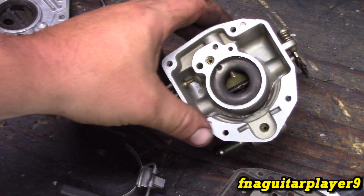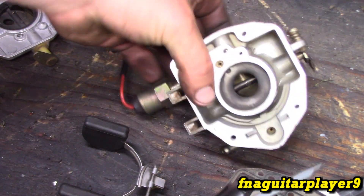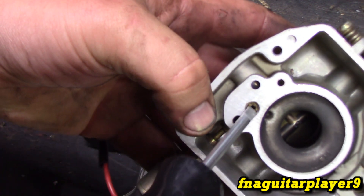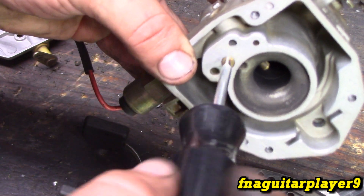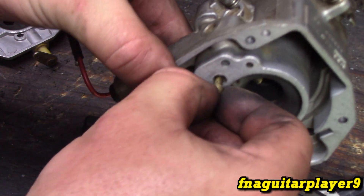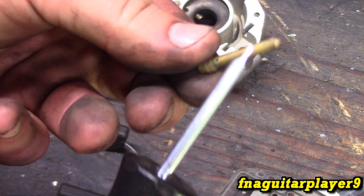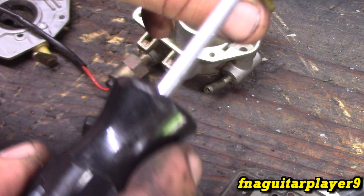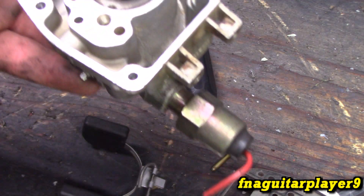Use compressed air to blow out the bowl - make sure you have safety glasses on when you're messing with carburetor cleaner because it's nothing to play around with. I highly recommend picking up a set of jet tools; it makes things a lot easier. If you look down this hole here you'll see the small jet - it's actually more like a nozzle. You've got a couple holes, one here and one down towards the bottom, and there's a hole that goes through it, so make sure all these passages are cleared out. Now I'm going to go ahead and take the fuel solenoid off.